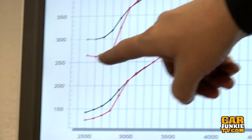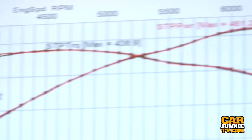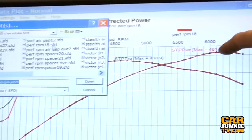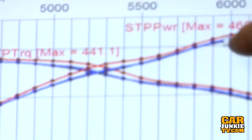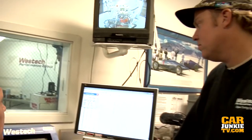We fixed the problem at the bottom end. This is the stock intake and this is the one with the plenum divider milled out a little bit — we matched the power up top. If you lay the Air Gap curve on top of it, this modified Performer RPM is nearly as good. If you're trying to build the ultimate stealth combo where nobody knows you've modified anything, the original Performer RPM with the milled-down plenum divider is the way to go. Put the factory fill tube in front, paint it orange, put 283 valve covers on it, and we'll be heroes.